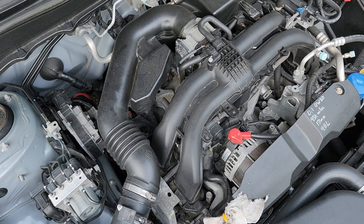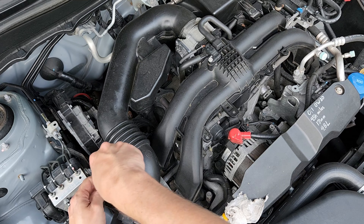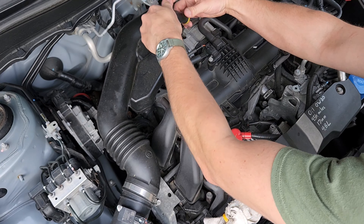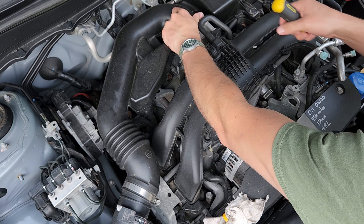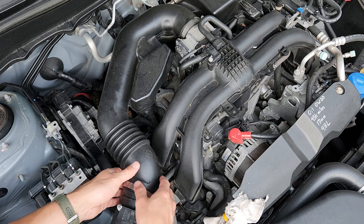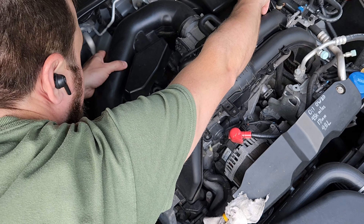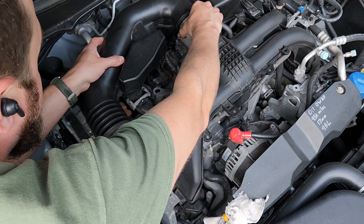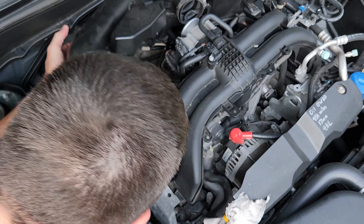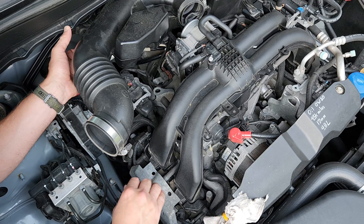With a 6-in-1 screwdriver — this guy is the correct size for the worm gear here — I'm going to make that nice and loose and do the same up here. There may be a hose somewhere back here that I have to remove as well. While we're back here, we can look for any kind of rust corrosion, scuffing, anything like that. With parts rattling, everything seems okay.